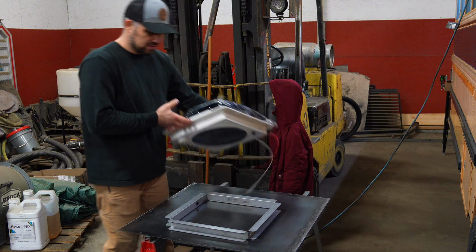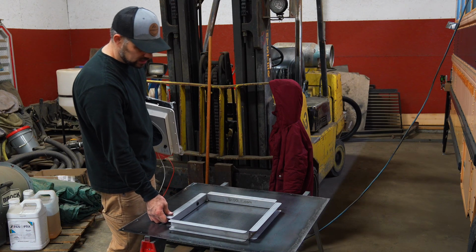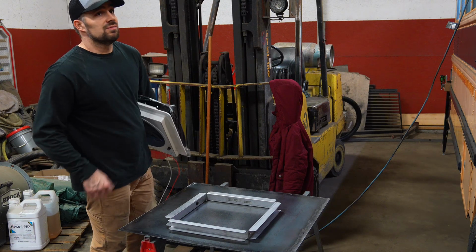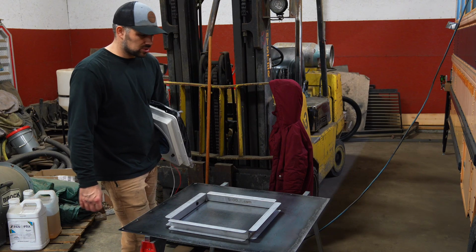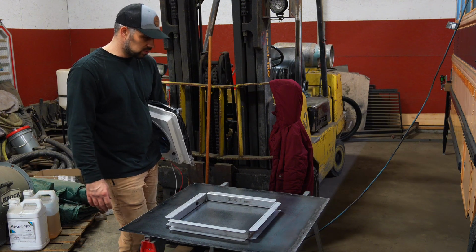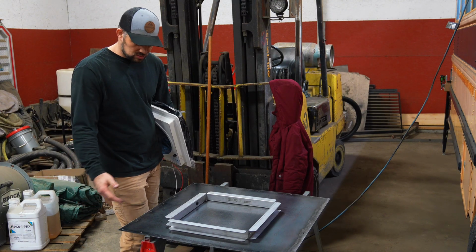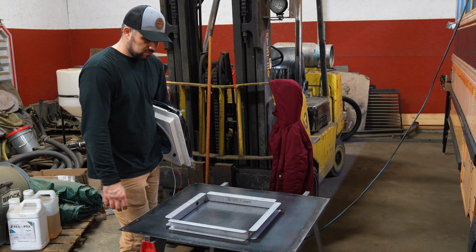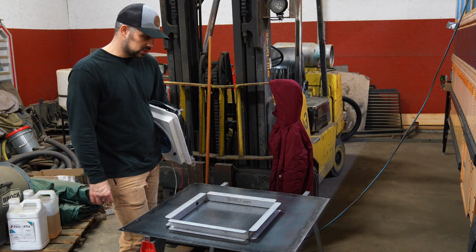I've got to figure out where this frame is gonna live on this patch panel, and then I need to cut the hole for it. And then we can possibly get the vent fans up today. I've already got this one laid out for the rivet holes. I was just trying to figure out spacing and where the holes need to go to hopefully get the best clamping force. We've got some high strength structural rivets for that, some self tappers for the frame and the fans, and a bunch of caulking and sealing stuff.